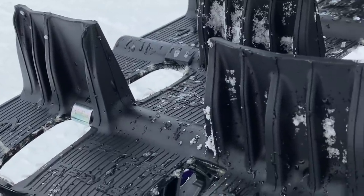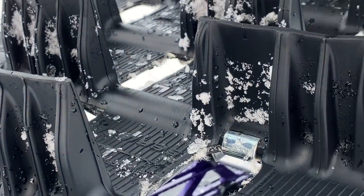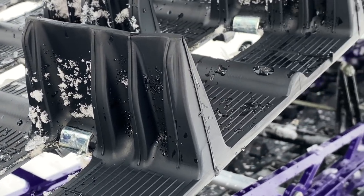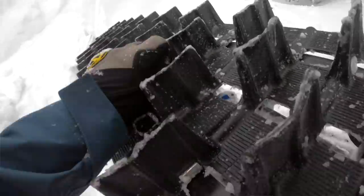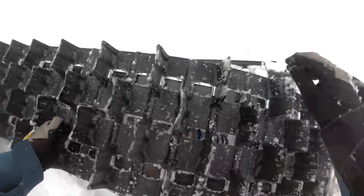With the larger pitch, the Series 8 track eliminates a couple rows of lugs — where the bulk of the weight comes from — and uses a thinner belt, making it a lighter track overall. If you order a 2021 with Quick Drive 2 and the 2.75-inch track, you get the lightest 850 setup possible. In our opinion that's the best track to order for a 2021. We don't get deep powder days all year long, so across a full season we're better off with a slightly shorter lug.